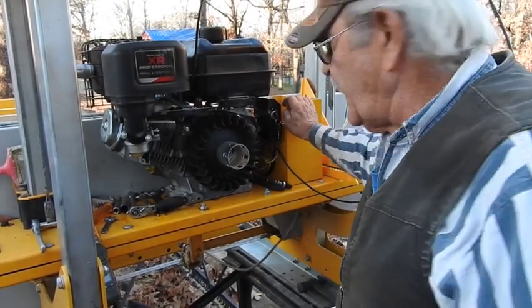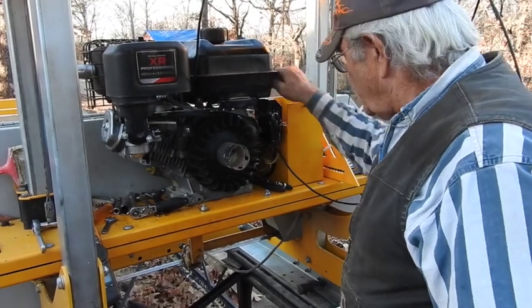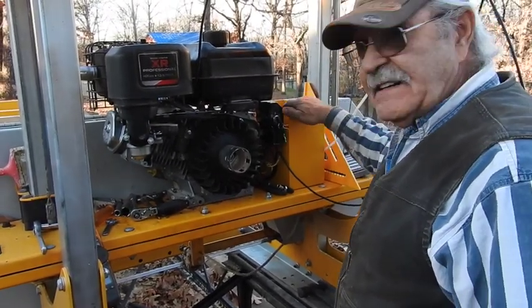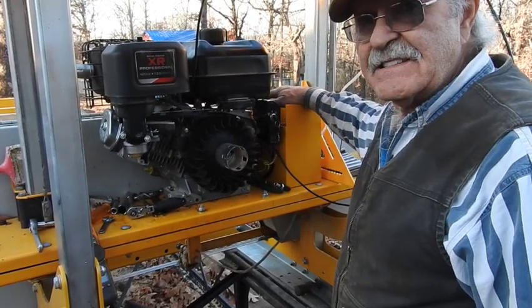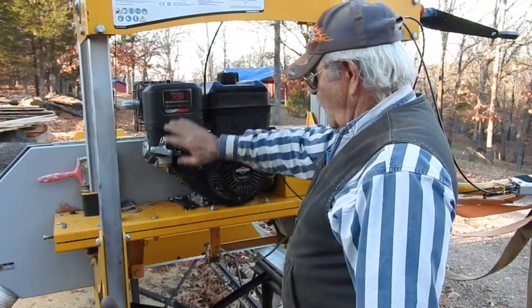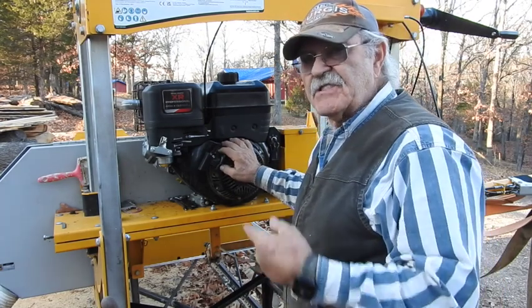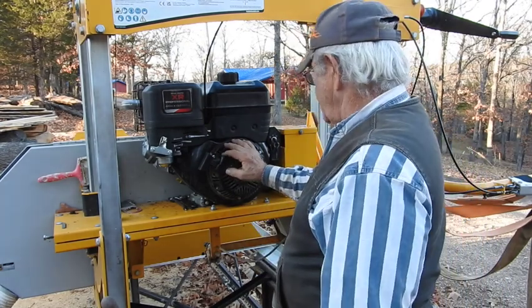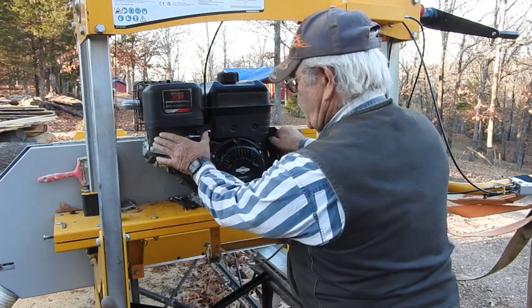I just want to check it every step of the way. One of the things I'm going to address in the very near future is the lid of this — I'm going to seal this lid so they don't have this opening to allow those mice to get up in there, build those nests, and make a mess all over the inside of that battery compartment. I'll do that very shortly. It's all back together now, don't have anything left over extra, and that was about ten minutes ago whenever it just started. So it should fire right back up again fairly easily — let's go ahead and give it a choke and a little bit of throttle.